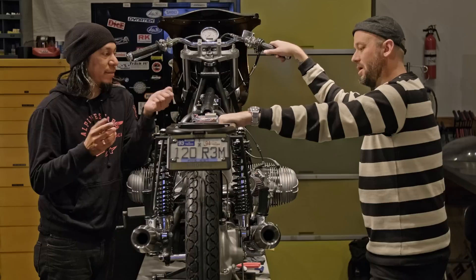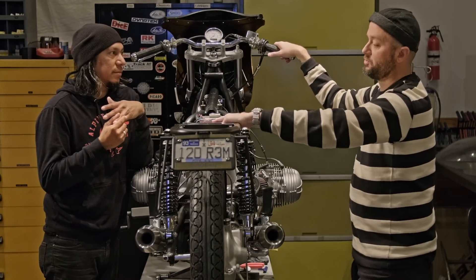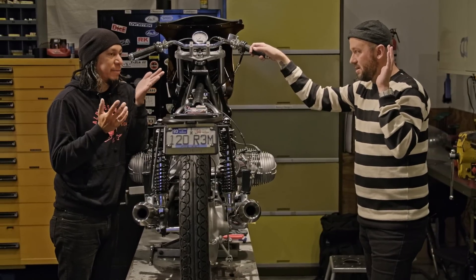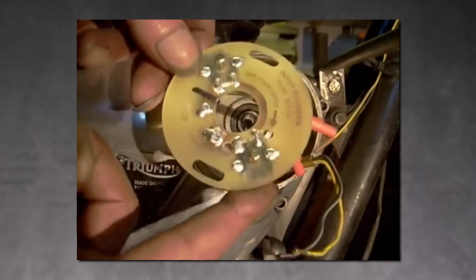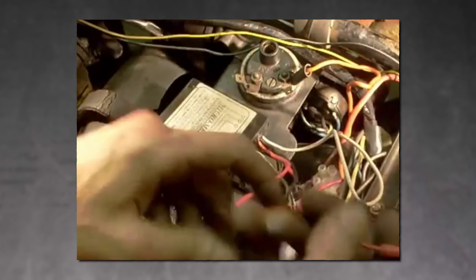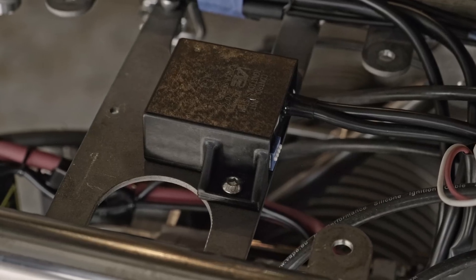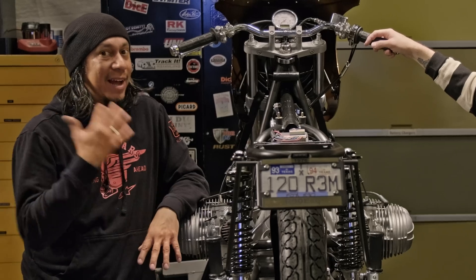I've heard people say that when an electronic ignition box goes out, you're screwed — whereas with points, if you're on the side of the road, you can at least repair it. Yeah, if you carry an extra set of points it's simpler to repair, but the electronic ignition should have a duty cycle exponentially longer than an engine could ever last. They're absolutely reliable. And 20 years ago — sorry Boyer — the Boyer ignition boxes were a common failure point. You'd buy one for a vintage Triumph for three or four hundred dollars, and occasionally the box would just die. But today that's not the same. There are many options — the C5 ignition systems, the VAPE ignitions for BMWs, Moto Guzzis, and some British bikes — basically a combined charging system and ignition all in one, which also gets rid of a lot of clutter.